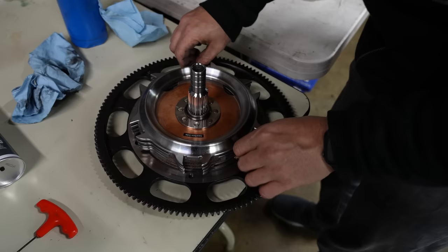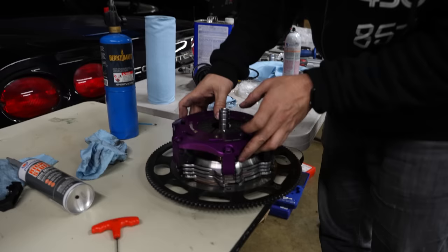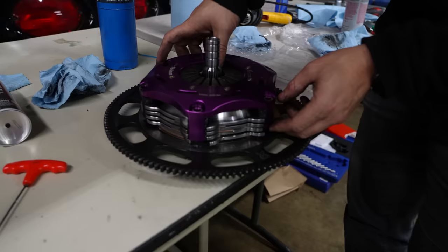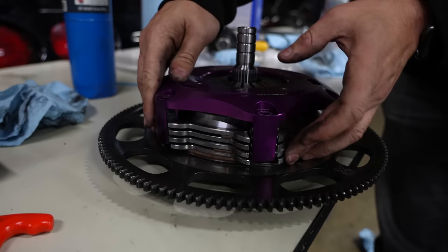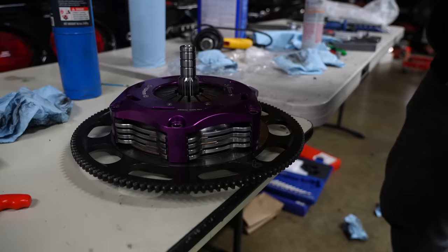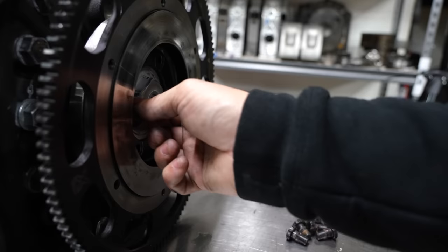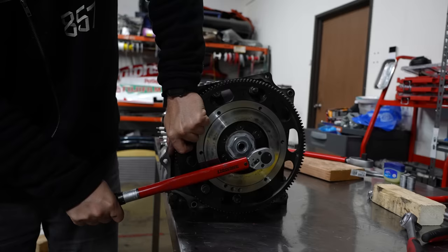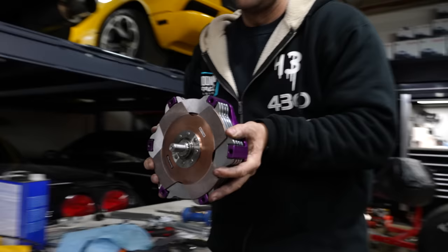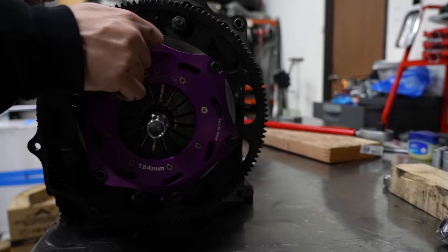Between each of these bolts, it feels like brand new all over again. So you can see there's those friction pads on the side that are meant to hold the plates because the plates are all moving and chattering, and even when you open and close the clutch, those plates have to do something. Everything is oil-free, dust-free. We will put this on here, and we're gonna use red for this. I love four-plate clutches so much. This makes my heart sing.